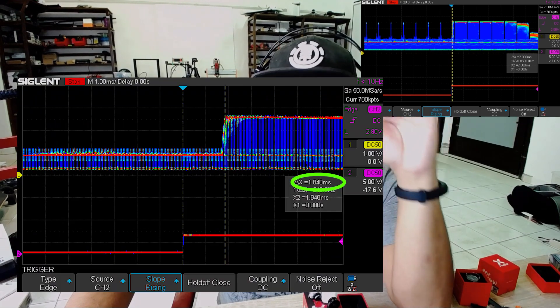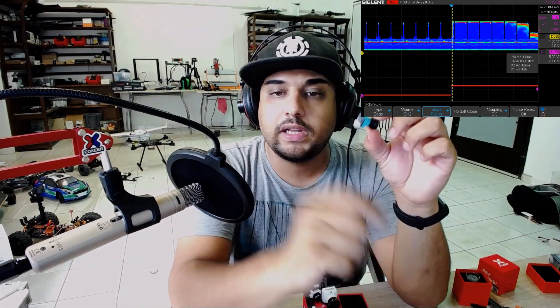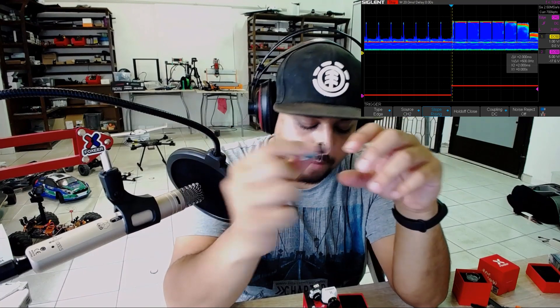The latency for the newest Nano here was pretty insane — it was averaging two milliseconds. It's a plus or minus 0.2 milliseconds, so anywhere between 1.8 to 2.2 or 2.3 milliseconds — really fast. What you want is something below 25 milliseconds. I prefer under 15 milliseconds, but when you start to get to 35 milliseconds, that's when it becomes pretty noticeable. Under 25 you're usually good, under 15 is awesome, under 5 is just insane. So this is in the insane category, which is a really great thing.